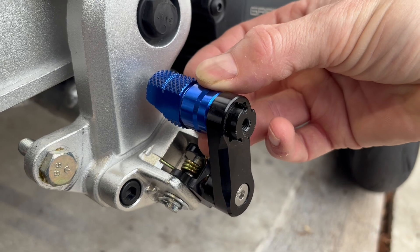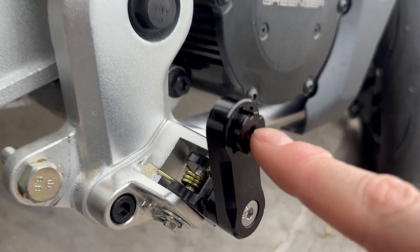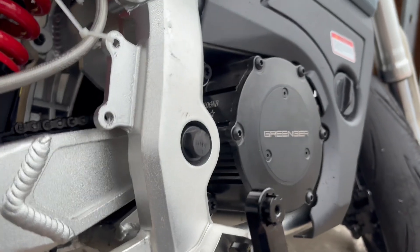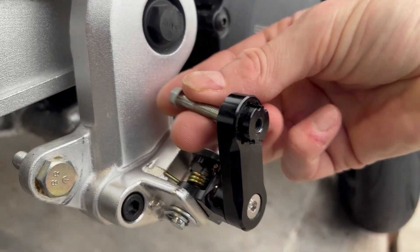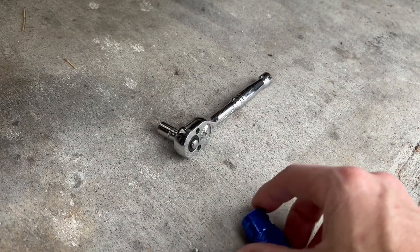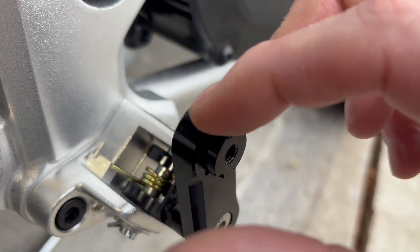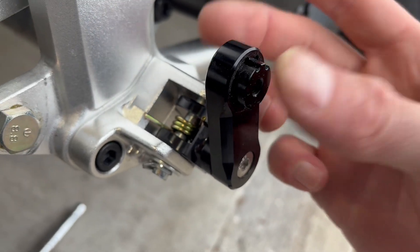It's going to look like that. This part is going to be a little awkward — it has a little bit of a grip which is good because that'll dig into the boot. What we need to do now is that the bolt has to go in from the back side of the mount, so that's going to be a little hard to tighten. Because we're mounting things backwards, the bolt that came with the foot peg is a little bit shorter. I want a slightly longer bolt so I have more threaded area and it's a little more secure.